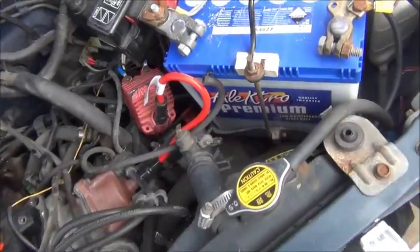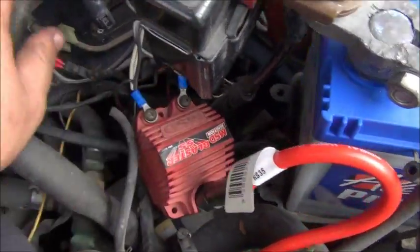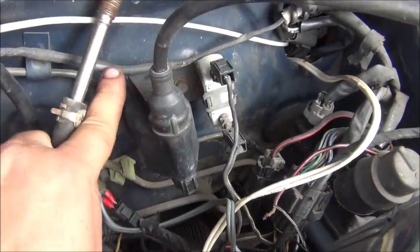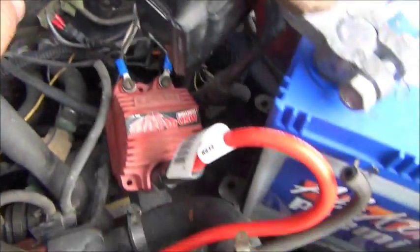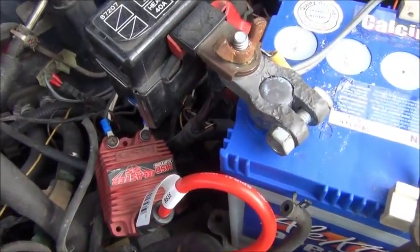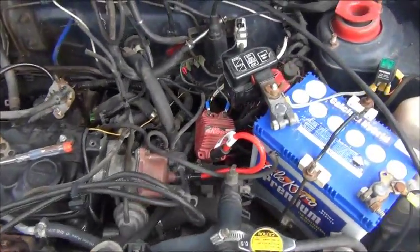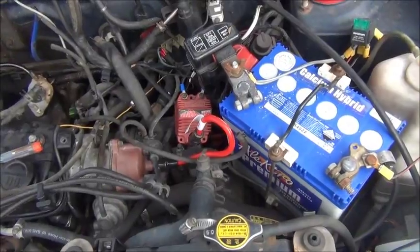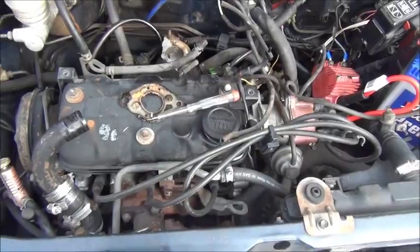I expected a lot of fuel varnish and muck but there hasn't been, so quite lucky. I've upgraded the ignition system to an MSD Blaster SS coil — it's a big transformer type, a flyback type. This one's got everything built inside, completely concealed. Still using the ballast resistor, but the Blaster SS should definitely give a much bigger spark than the original. It's an MSD part designed for high performance, so hopefully I can eliminate my high-boost misfire problem.